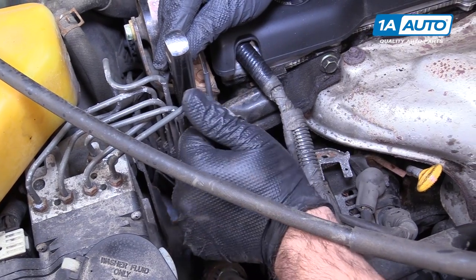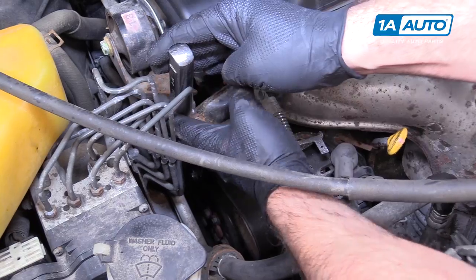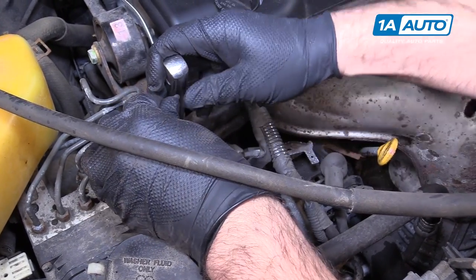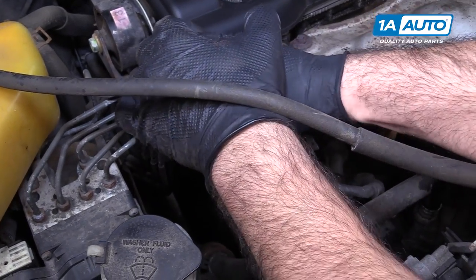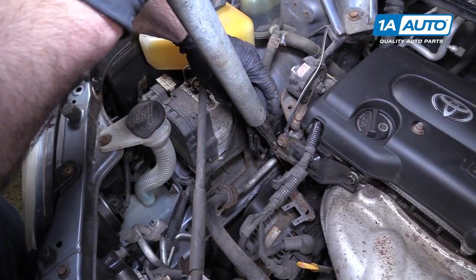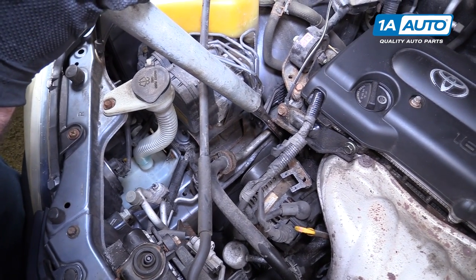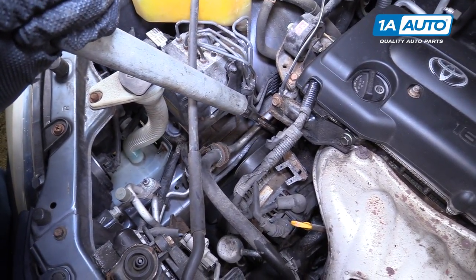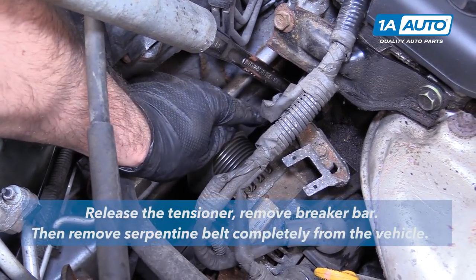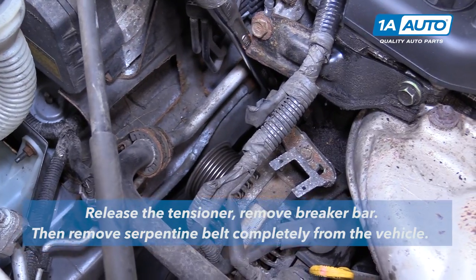You've got a bracket here, and there's a brake line that comes out, so you just have to be careful to not bend them too much. You're gonna do the same exact thing — just reach in here and gently pull it and it will compress. Kind of push this out of the way a little bit, pulling to the front of the engine. I'm gonna carefully put a pipe over the end of this breaker bar, just to give me some more leverage, and then gently pull down and compress the tensioner. You can see the belt releasing. Reach down and walk it right off the pulley, then release the tensioner. Now you can remove the breaker bar from the tensioner and feed the belt off the rest of the pulleys.